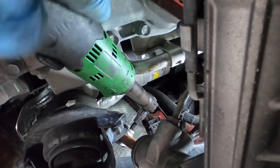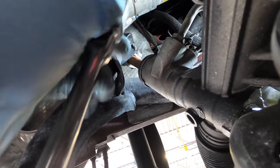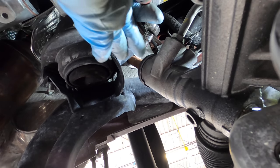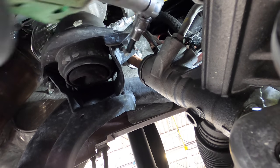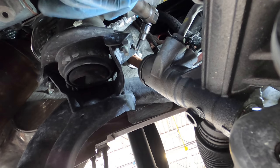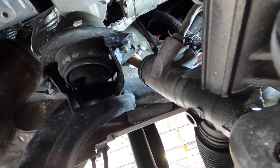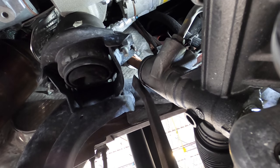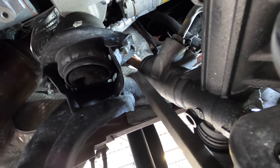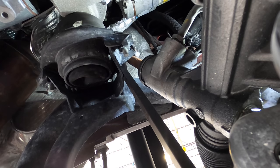Can't break it loose — need a ratchet. The teeth on that electric ratchet were not fine enough. It might actually be a T55 — no, it's a Torx 50, it just felt sloppy. We'll give it a running start and just send it. That's a great way to get your tools warrantied. There's the head of the fastener — a little bit of pry bar and some hammer tappy-tap action, and that thing should slide off the shaft. There it goes — it's free.